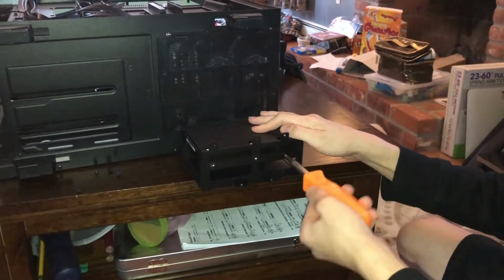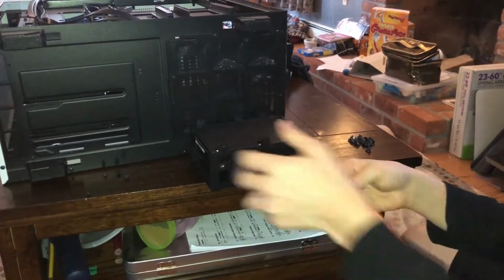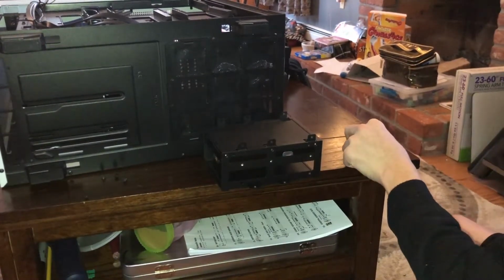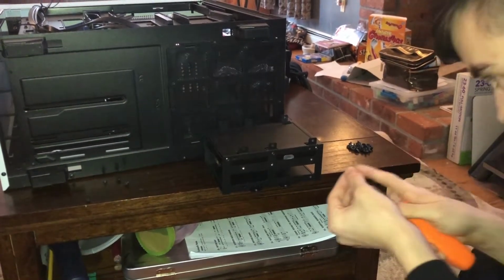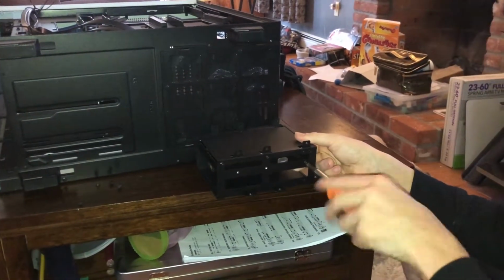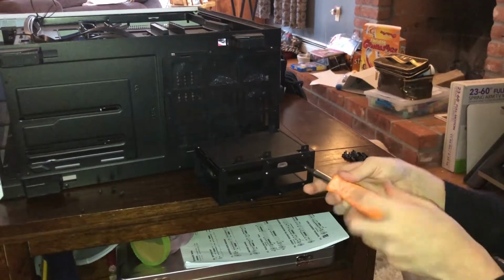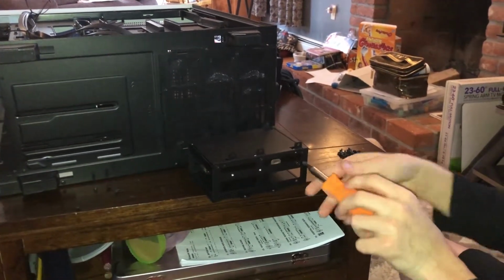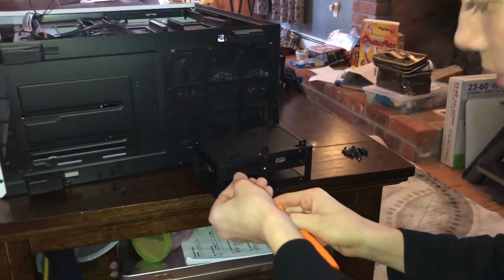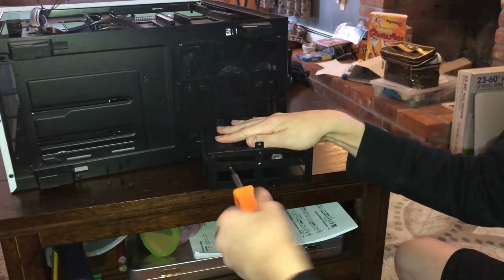So you just screw one in. I think we'll do this in a crisscross pattern as well. Flip it over here, grab another screw, put it like this. You might have to raise your hard drive a little bit to get the holes to line up, but once you go like this, you are good. So we've got 2 in now. We'll connect it on this side. We don't need to connect the middle one. That one's just stabilization, and with 2 on each side, we'll be fine.